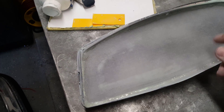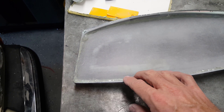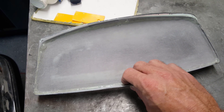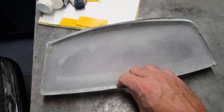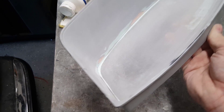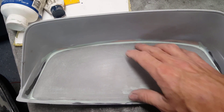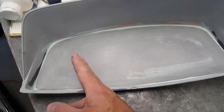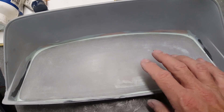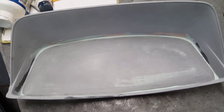The back nobody's going to see, so I'll just smooth it out a little bit, but I do want it thicker in the corners so it's stronger when it's in the dash. By doing all this I gain all the real estate I need for my gauges — a four-inch gauge, the three and three-eighths quad gauge, and the square OLED display for the transmission computer. That gives me everything I need: a modern dash in the classic W123. Thanks for watching.